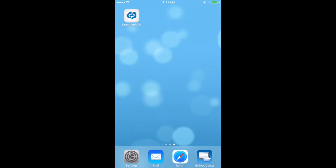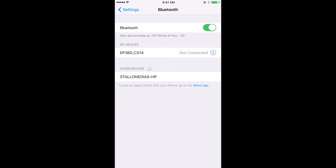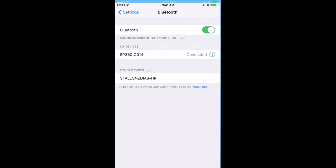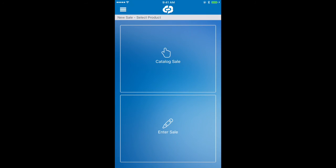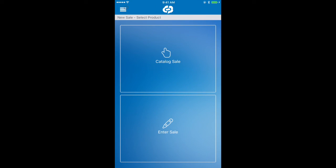Let's tap the home button to find the settings button and go ahead and re-pair. Tap Bluetooth and tap on the reader again to connect. Now we should see that the reader is connected — great. Let's return back to the DreamPayments mobile app. From the menu button in the top left, tap that and tap scan for card reader. You should see the app thinking for a few seconds, and there we go — we have a green check mark and you've completed the card reader update successfully.